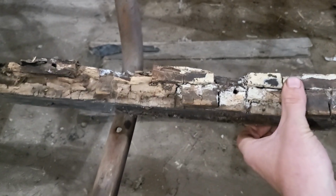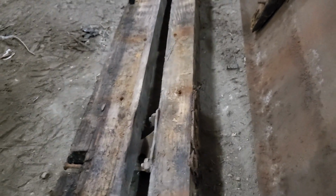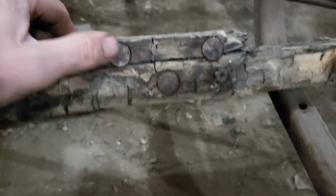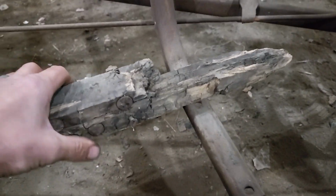So this side, driver's side, this is all that's left of that main frame rail, and it is just a completely gone piece. But I've got my metal bracket. Interestingly, there's no backing plate here. This one, you can see, has a doubler in the back, a metal backing plate that clamps that mount to the wood. Same in the front. There's a backing plate, and this one hasn't got that backing plate, and I highly doubt that it ever did have. You can't really take it apart to remove that. So it was assembled without that.